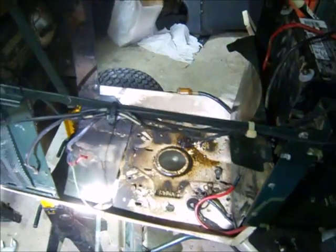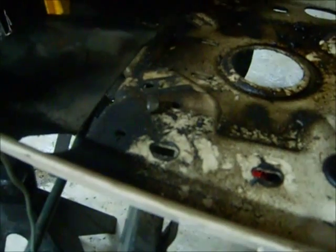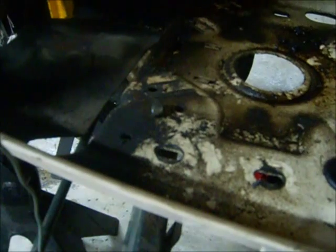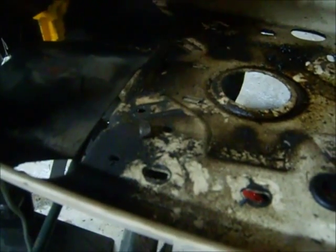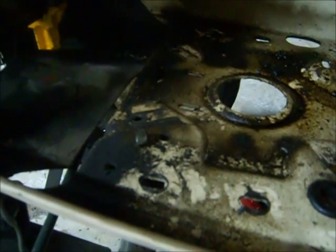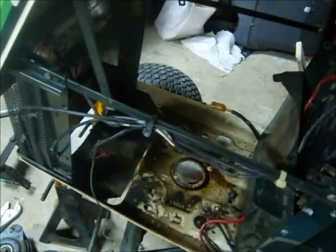The other lovely part about this is where the motor mounts are placed. The two front motor mounts were sitting right on top of this axle. You could get a wrench on it, and I was able to get the motor out — I got them loose and got the nuts off. There are nuts on the top and a bolt through the bottom. I pulled the engine out but the bolts were just sitting in their holes still, not dropping down because of the axle, so the axle had to come loose as well. It's just a funky design — kind of a pain.